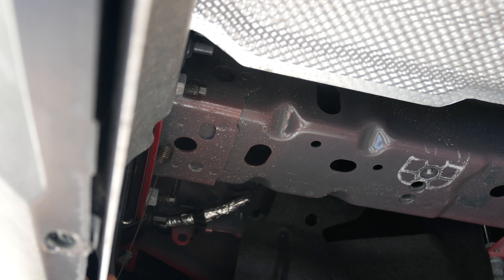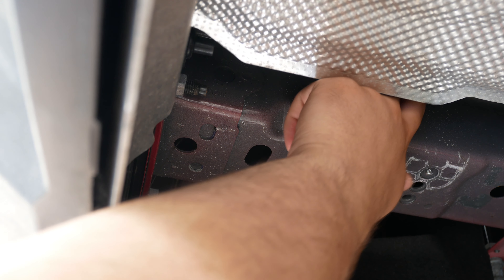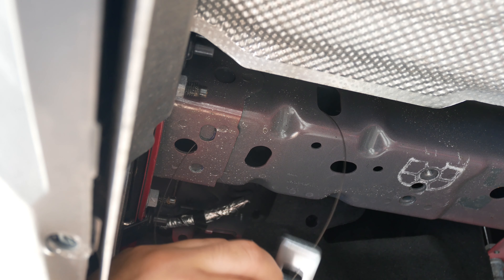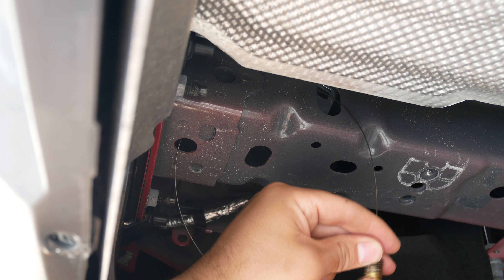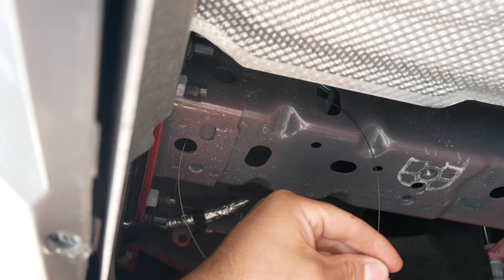Now for the hitch installation. Your hitch will come with six pull wires, which we will use to fish our mounting hardware through, as you can see here. Once we get the pull wire through, we're going to want to push through our bolt block and then thread on the bolt to the spring end. And once we have that done, we can pull it all through. It's easier if you send the bolt in backwards.